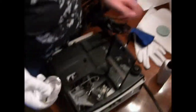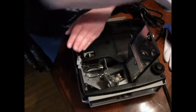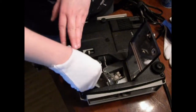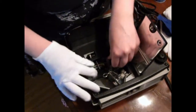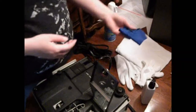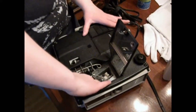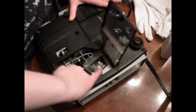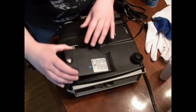Now place the lenses back into place in the projector. They'll line up with slots on the bottom and lock into place. And with the still-damp lens cleaning cloth, wipe down the mirror inside as well.